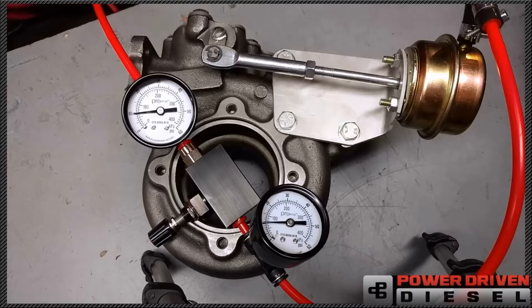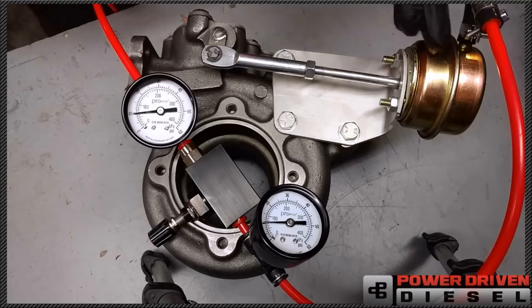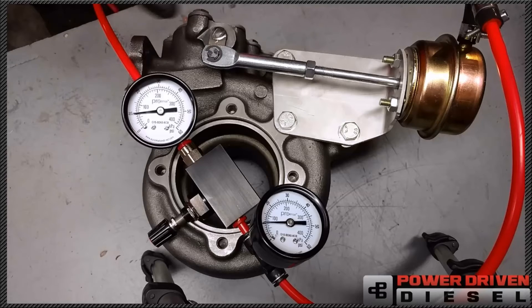The difference is there's a bleed orifice. All of those gasoline controllers have a bleed in them that bleeds out boost externally. They do that so you have a place for the pressure to go when you let off the gas — you need the pressure to go away so the wastegate can go back to closed. On a gas engine, that's not a big problem because they cruise around under vacuum, and when you're under boost, you won't hear that bleed orifice anyway.